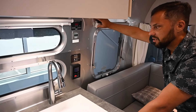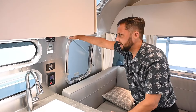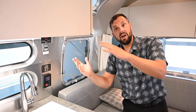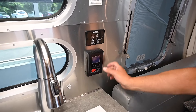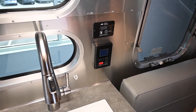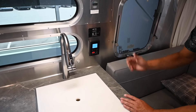There's a solar charge display showing the 300 watts of solar. On a bright sunny summer day with the sun directly overhead and clean panels, you could have 90 to 95 percent capacity. When the sun is lower or in partial shade you'll get a little less, but these Merlin panels are excellent. You can turn the inverter on and off from here, and you can also dial in and turn on your water heater — set the temperature to 124 degrees. If you want cooler water, just turn the temperature down to your desired setting rather than mixing at each faucet.